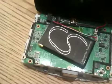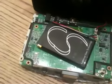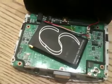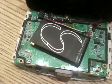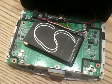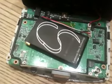The battery in my unit — I think it was the original, but may not have been since I didn't buy my unit new — was very firmly glued onto the motherboard. Using the credit card I just eased it off gently, being very careful not to damage any of the components on the board, and then plugged the new battery in.